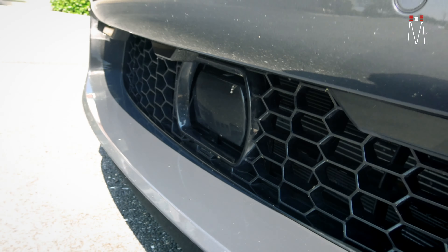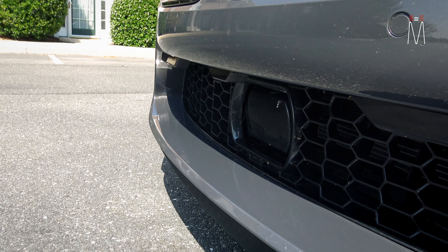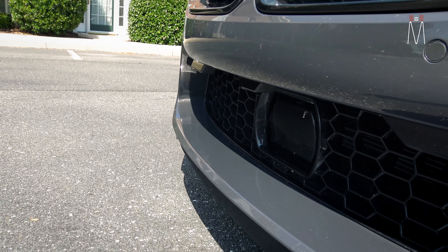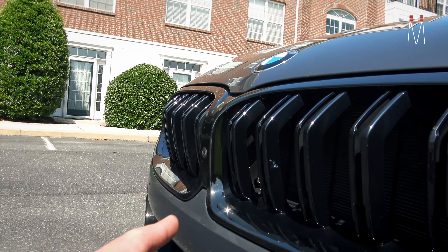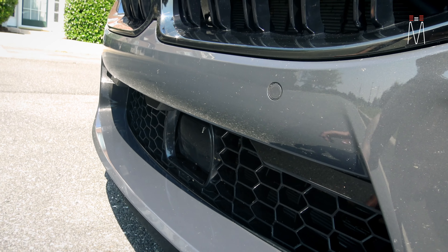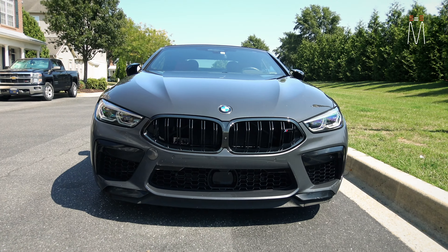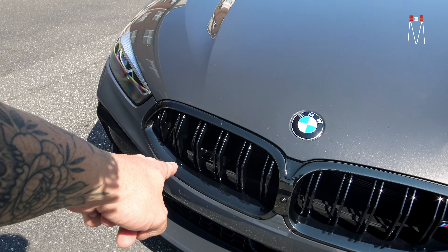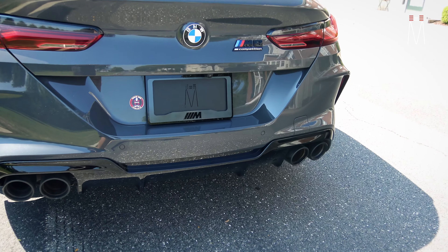It's made from the same material as the face of the sensor itself, so it's not going to block anything incoming. It keeps the sensors from getting wet and builds them into the car's front end. You can't even tell anything is on this vehicle. A lot of manufacturers do similar things — like that factory radar receiver in the center for adaptive cruise control. Mazda and Mercedes build their sensors behind their emblems; we're doing it the same way to add laser defense in an organic, 100% OEM-looking manner.